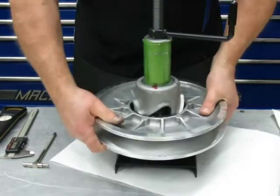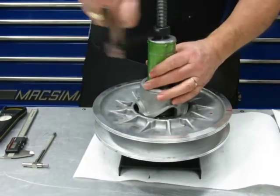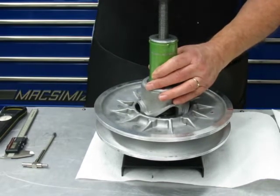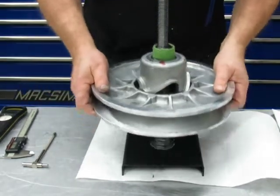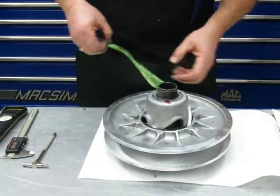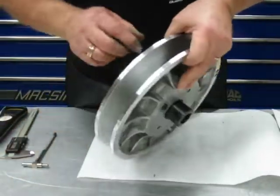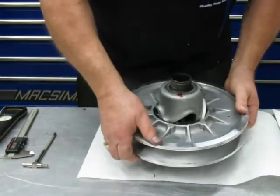Okay. So once you got the bolts in, you got it snugged up, you're going to take this off. It's not going to go no place. Okay? Alright. Take that off. You can take the tape off that protected your bushing in there. Okay. Now, as you see, the spring is back in original location. You got your arrows. Arrow here, arrow here. Okay. And we got the two bolts. There's two more going there, obviously, but we'll get those later.